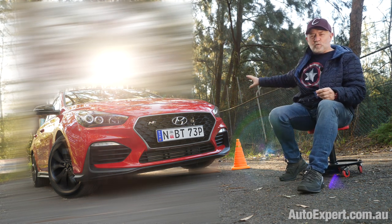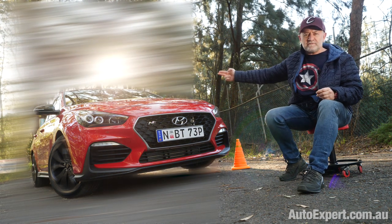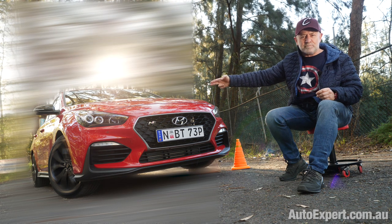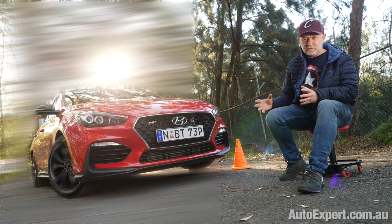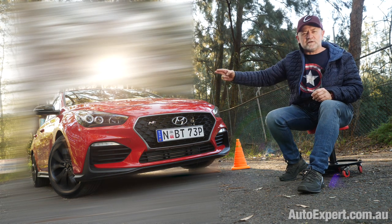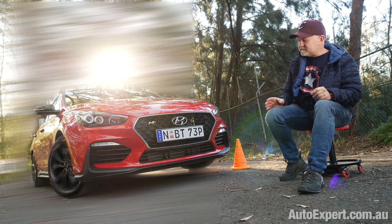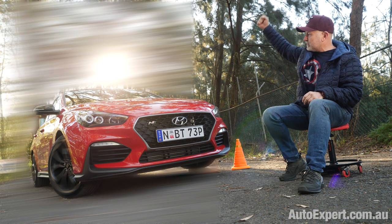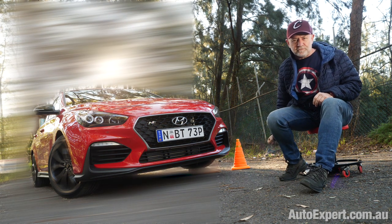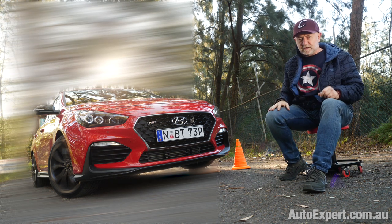What happens there is when the wheel would otherwise have been spinning, it is not. So the drive to the right wheel continues unabated, and it's got a lot of traction there, so it can get a lot of drive to the ground if only the differential allows it. So that's good. And another big advantage here, which you may not have considered, is that the center of rotation for yaw is like driving a crowbar down through the center of the roof or something. That's how the car is yawing. It's rotating about that vertical axis.